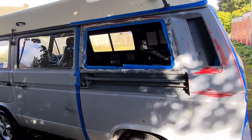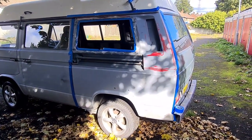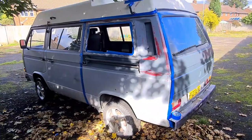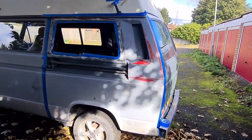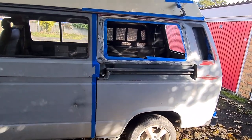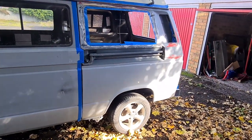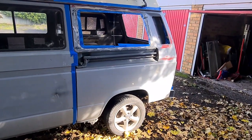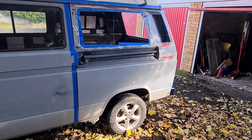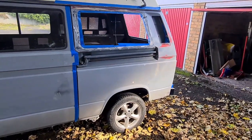Right then, guys, so where are we then? So, flatted back all that guide coat. Well, hands are shaking. Obviously the blue is the masking, so we're going to carry on masking it up now, and then I'll mix some paint up. I'm not going to put too much thinners in the first couple of coats and get some coverage, especially around that window, which is not great. I'll start putting some paint on. You've seen all this before, so I'll probably just do a finished photo. Obviously I've put tape on now, so I mentioned I'm going to spray outside, and the wind's picking up.